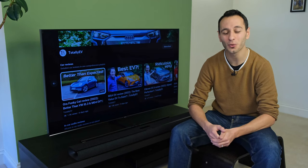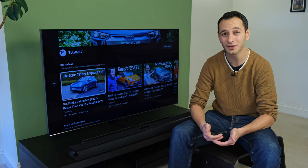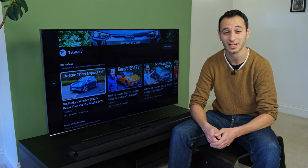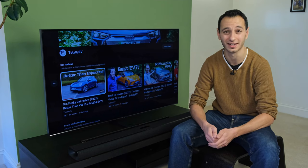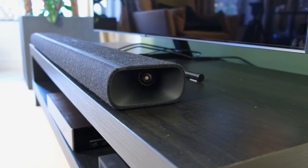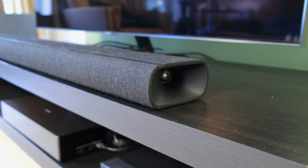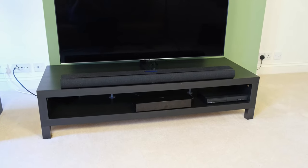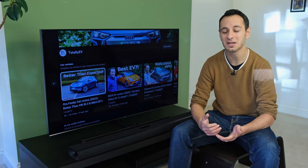With the audio demo out of the way, I should mention the soundbar setup. You've got 11 drivers that output a whopping 630 watts, at least according to the manufacturer. You've got a frequency range from 52Hz all the way up to 20kHz. Breaking it down further: 6 x 60-watt racetrack drivers, 3 x 50-watt 1-inch tweeters, and 2 x 60-watt 2.75-inch upward-firing full-range drivers.